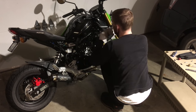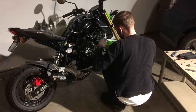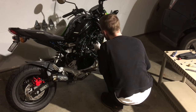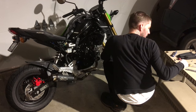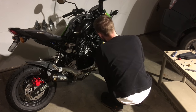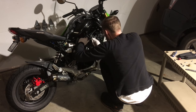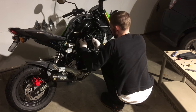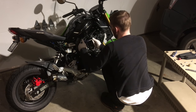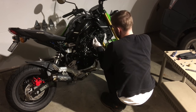And in terms of the power commander, it helps with the ECU interacting with the map on the power commander, because the OEM ECU is going to attempt to learn the new configuration, and the power commander is going to edit the fuel injector timing, mostly under wide open throttle, to richen up the mixture.